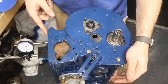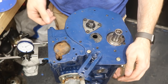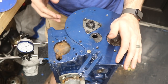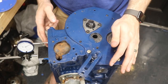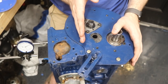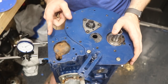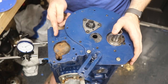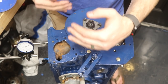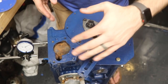I've already done that on my car using a degree dial indicator — this is important because without it, you can't really dial in top dead center. It's quite easy when the engine is apart like this: you're essentially finding the hesitation point at the fullest amount of lift on your first piston. Looking at the side with the thermostat housing — where the radiator would sit — your piston in its motion comes up, goes back down just a little bit, back up, and then back down. At its very peak, the movement is a tiny amount, and your degree indicator helps you find the difference between that and the actual center point.